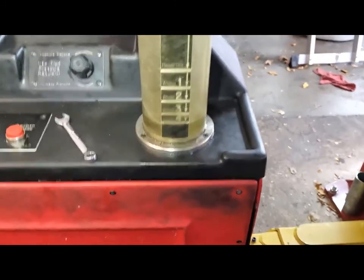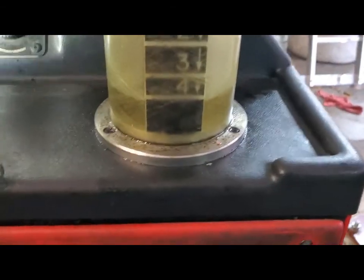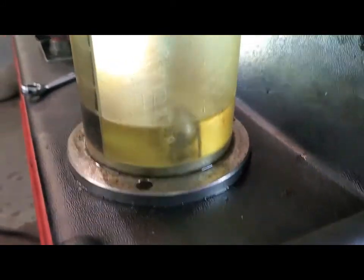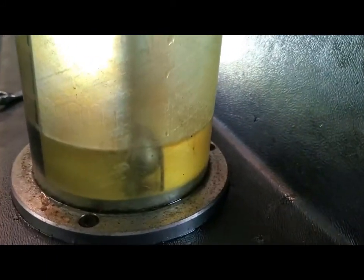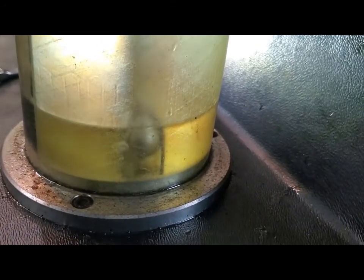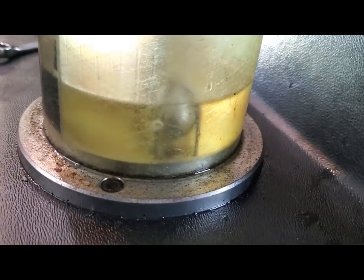As you can see, I'm at the bottom of the number 4 line. You don't want to drain this thing completely — in fact, you can't, because there's a steel ball in the side of it that gets sucked down in there and shuts the thing off if you drain too much fluid out. That's to prevent you from getting air back in the system.